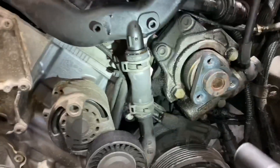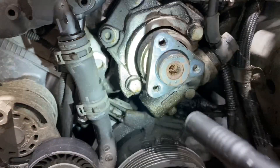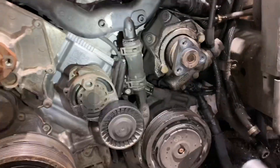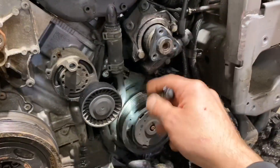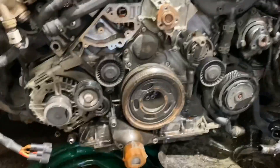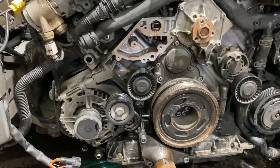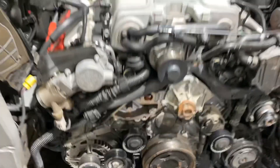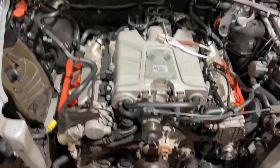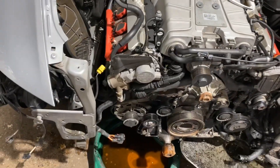There's another port on that side, right over there. I'm going to take that out. I'll have to take this pipe off over here and move the AC compressor out of the way. We're going to take the down pipes off — number one because we're doing the flex pipes, and number two because we're going to be washing and cleaning those ports.